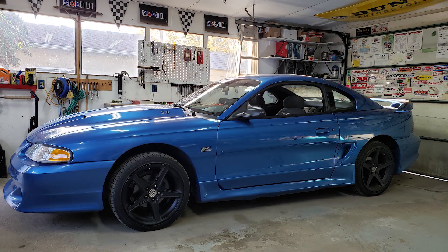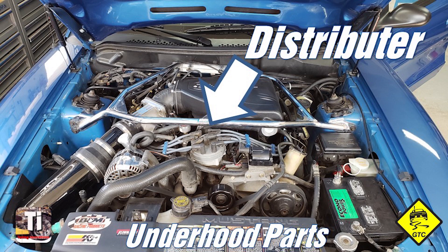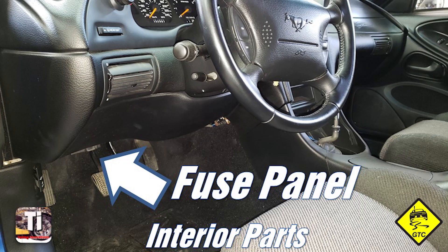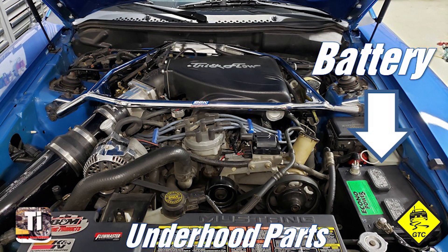First off, let's find the parts we're going to be talking about. For this video, we'll be using Fred's 1994 Mustang GT, because it underwent the same diagnostic procedure over the summer and prompted this video. Don't worry if things look a little different on your Mustang — all the parts we're looking at are going to be in the factory locations on Fred's car. Looking underhood, you'll need to know the location of the coil near the power steering pump, the distributor and connector on the front middle of the engine. The TFI module is mounted on the passenger side inner fender — it hides under the stock airbox and can be quickly identified by the aluminum heatsink. On the inside, you'll need to locate the fuse panel near the hood release and the check engine light on the dashboard. We'll also be interacting with the battery.